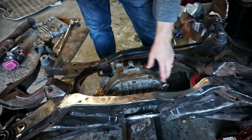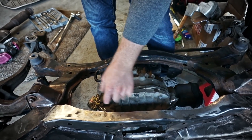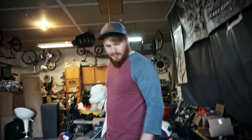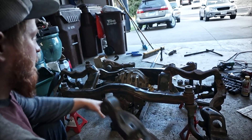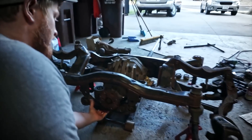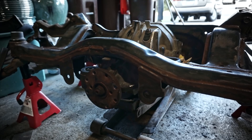Since I cut off the horns, I'm going to mount the pumpkin at the rear using these top three bolts. I'll make basically a little girdle where those bolts go, and the girdle will then bolt to the subframe. The front mount is pretty cool on the Legacy - on a Forester or Impreza subframe, the front diff mount has like another mini subframe that comes forward, which is kind of weird. On this one it's really compact: basically two bushings that just go up and mount it. I'm probably going to hard-mount it with no bushings to keep it positioned where I want.